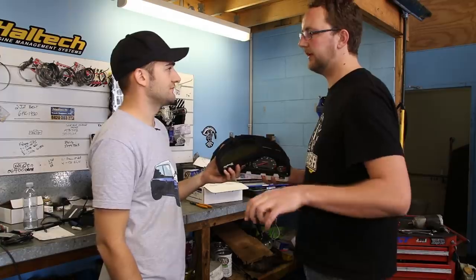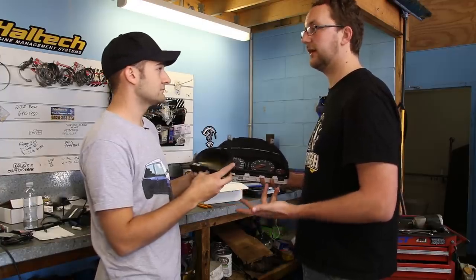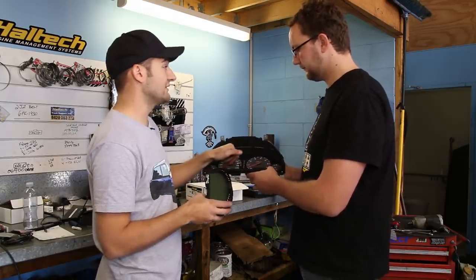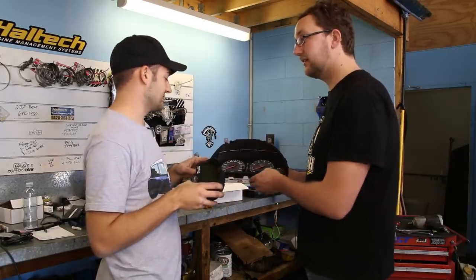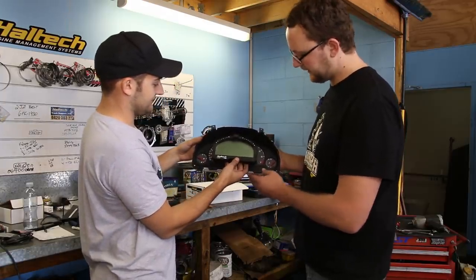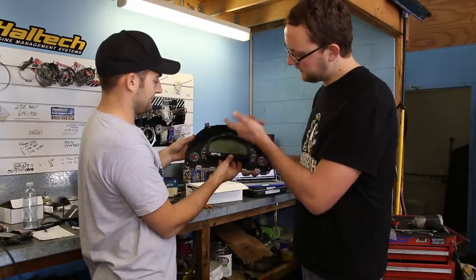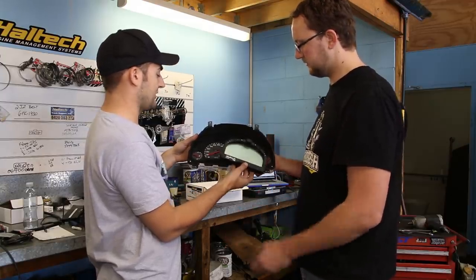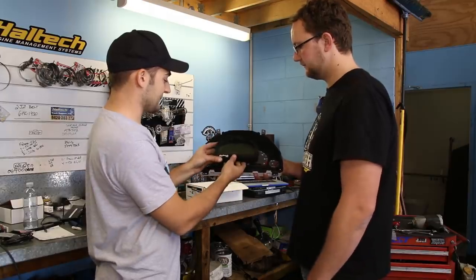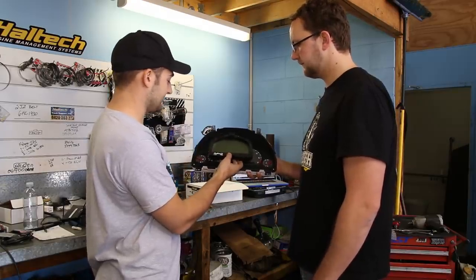The only things we might still need are body-related things like doors open, blinkers, handbrake - stuff not included in the ECU data. We'll probably still use the current fuel sender because this dash will just sit over it, and that makes the wiring heaps easier as you don't have to do the calibration again on the fuel level. All the indicator stalk stuff up the top you can still see easily. In our case, we'll stick it in front - we plug one cable into it, that's it, and it will display everything. Al then strips out the wires from the loom that will connect up to the existing Subaru body harness.